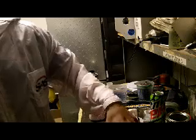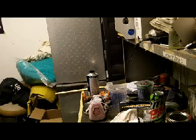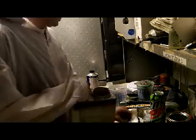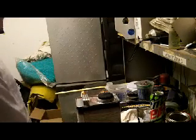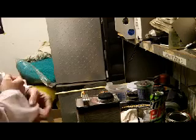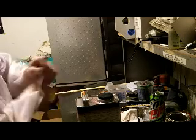Got our mixing cup. We're going to use the MS-30 speed clear with not the normal hardener, the slow hardener, but not the very slow, the 6 hardener. That's what I got, unfortunately. I just got to be careful. That's what I used on that van.